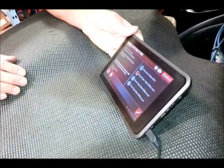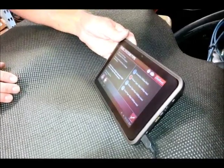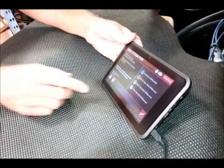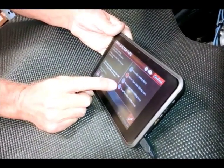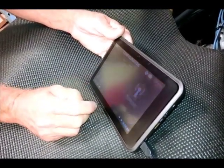Here's the type of fuel system we are running. On this vehicle we are running our sump at 60 psi, which is a 600 max horsepower system. So we select that.